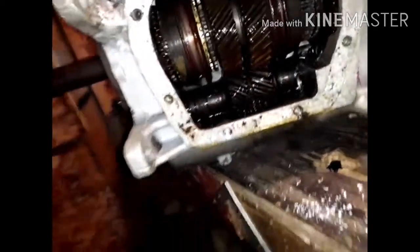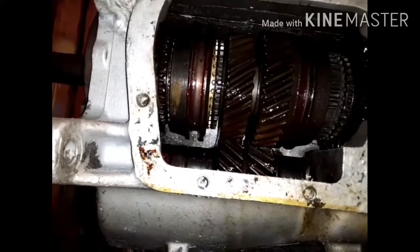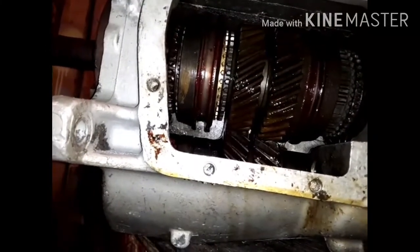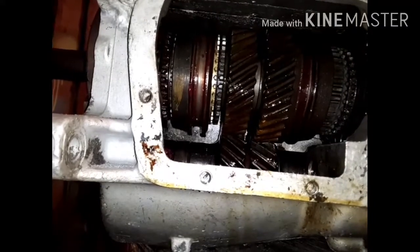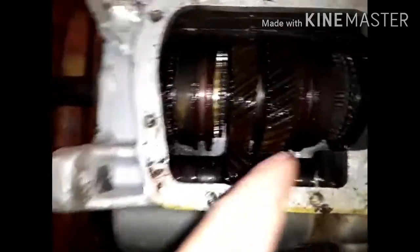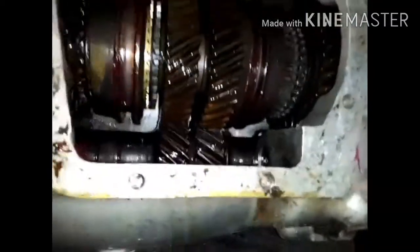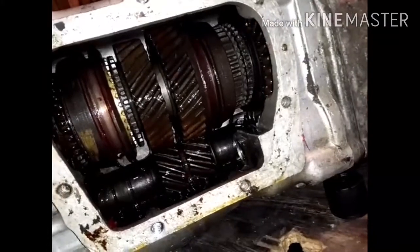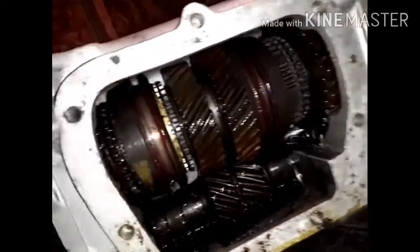One thing I can point out — even knowing everything in this transmission is used, from the bearings to the gaskets to the synchronizers, everything is used. It was put together out of a bunch of cast-off parts that weren't good enough to use 40 years ago. This is an early hub slider and this is a late one — you can see thin synchronizer, thick synchronizer. That's just what happened to be good, so I mixed and matched. We'll see how this works; I may end up breaking something.